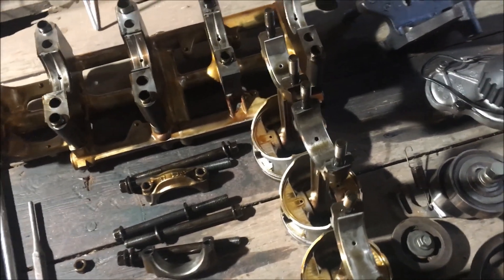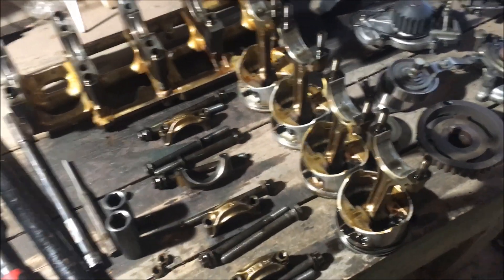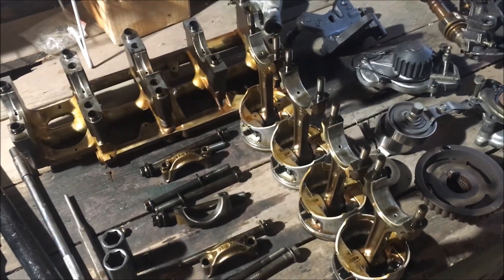So that's not good. Luckily I'm replacing the pistons anyway, and the wrist pins as part of the build. I'm actually in disbelief — I was running this car all the way home with both cylinder two rod bearings spun, and that's why I was making that clanging noise. I literally can't believe this happened, but we're going to move on.